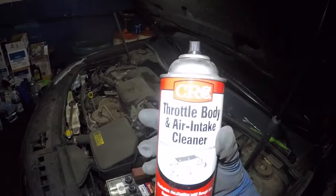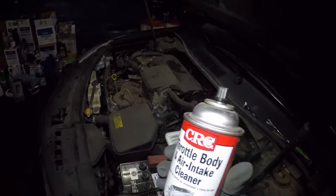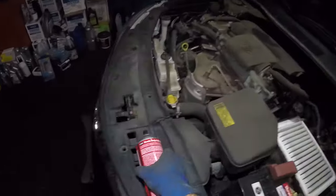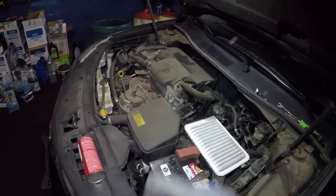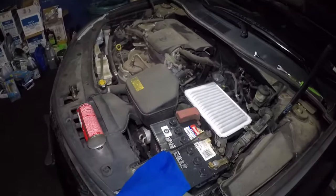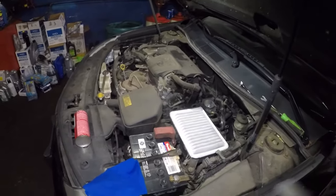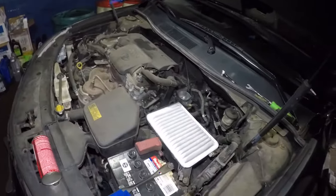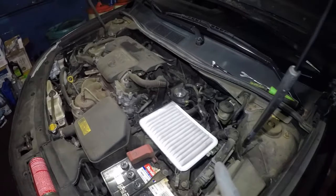This is the spray you're gonna need — it's like a $12 spray and you can use it on multiple cars. You'll probably have this the whole year and could do 10 services on your car. Other than that, you're gonna need a small rag and you want to be careful with your hands. Have somebody help you — my friend here is gonna put the car key on accessory and press the gas pedal. We're gonna demonstrate that once or twice so you can see how the throttle body opens up.